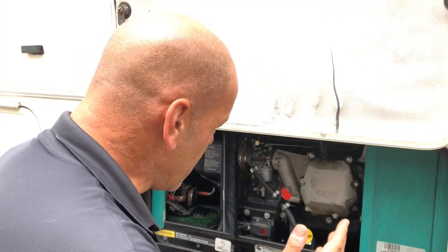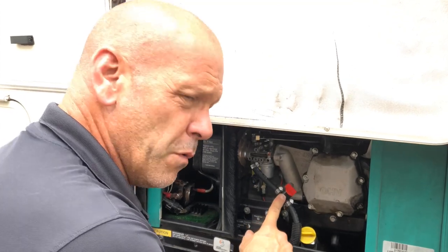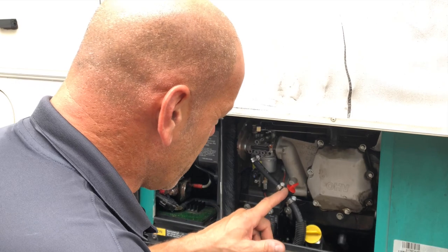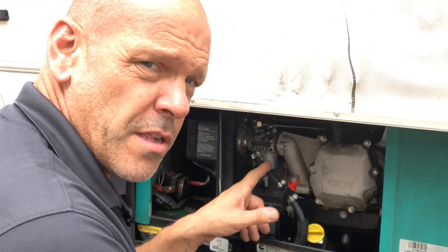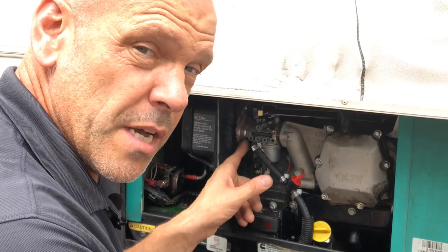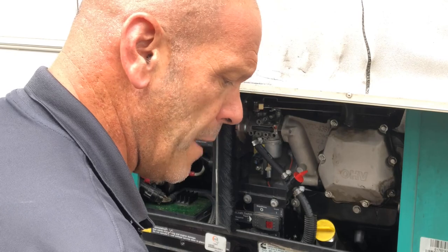Okay, so the first thing we need to do is drain the float bowl of any fuel before we get going. Now, I've fitted a fuel shut-off valve, for the beady-eyed among you that may have noticed, because I like to drain the carburetor bowl when I leave the RV for long periods of time. There's fuel in it at the moment, and I'm going to assume there's fuel in yours, so I'll show you how to get that fuel out.